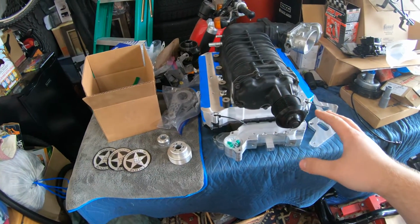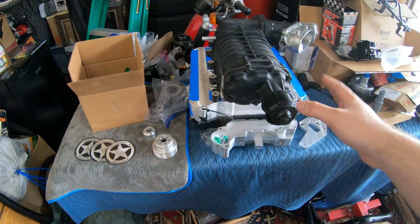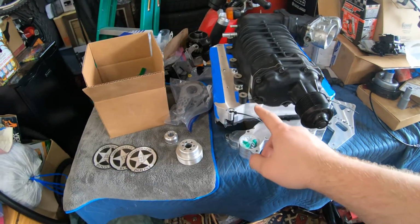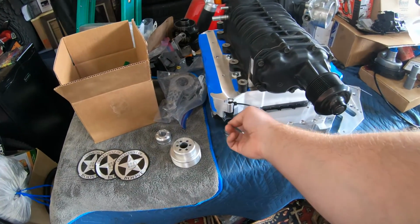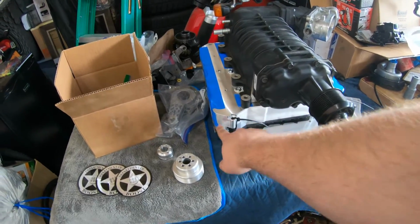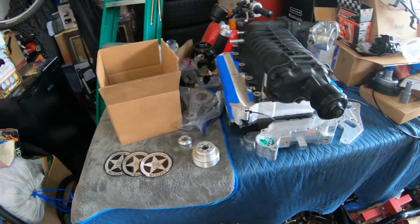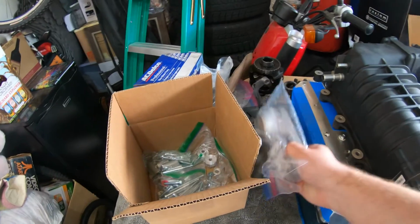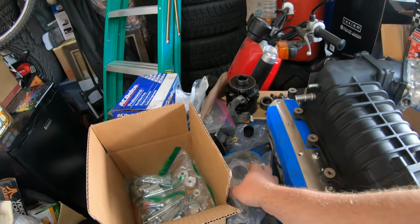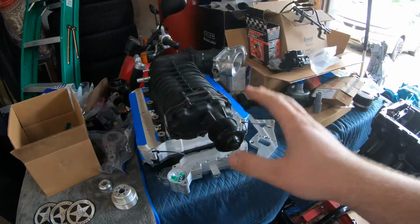I'm just going to be going over some things with the kit that I spec'd out. They have a new website that makes it really comprehensive. I got the manifold with the heat barrier. It's a composite heat barrier that basically just lowers the temperature between the manifold and the cylinder head. Also got the Franken tensioner, so I'll have to set that up. This basically just helps with setting the correct belt tension because there's a lot of issues with those.